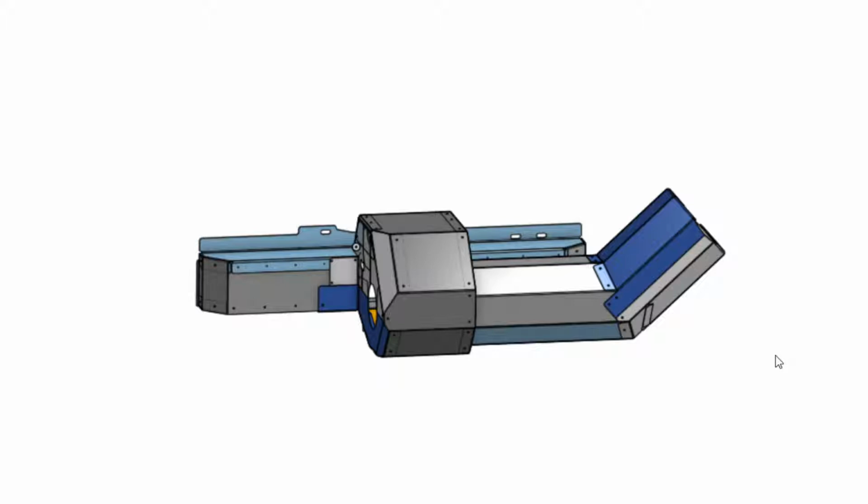That system requires a different design of tin than the later ones that I initially designed the tin to fit. I didn't realize that early version existed or was different, and so the tin that was initially shipped for those kits didn't fit to enclose the wastegate actuator and the wastegate turbo on it. Also, they moved the turbocharger and the exhaust pipe out a little bit on the later ones from those earlier ones, and so there's a mismatch there in terms of a dimension as well.